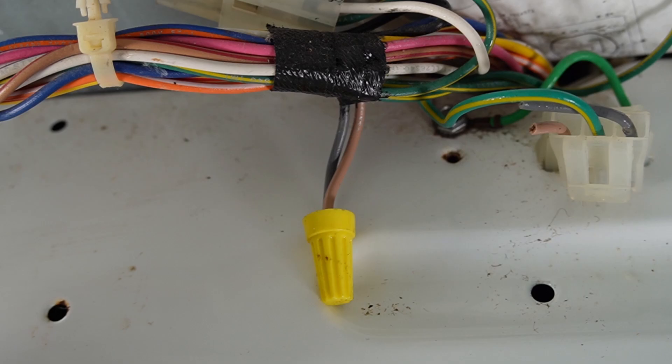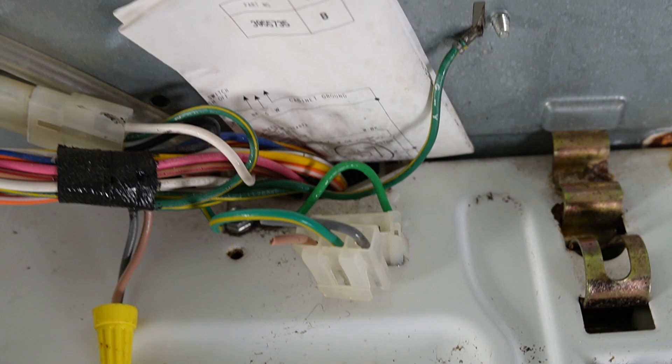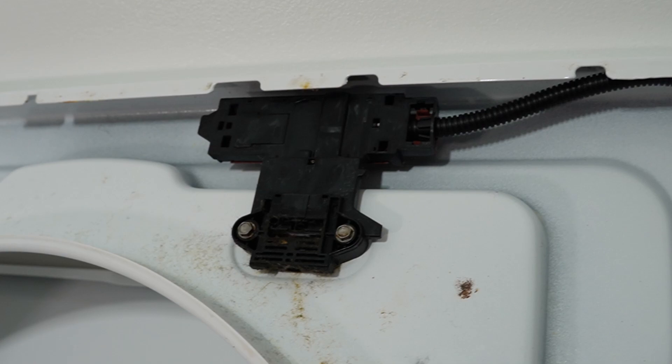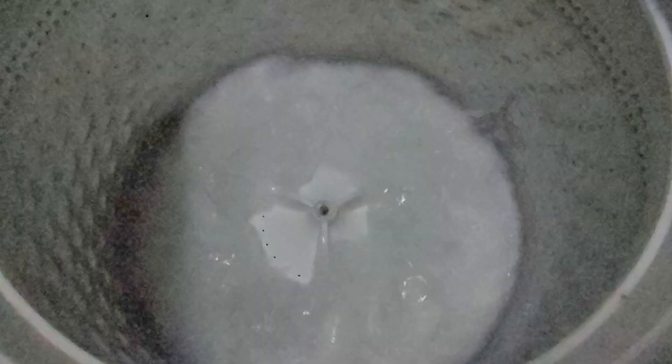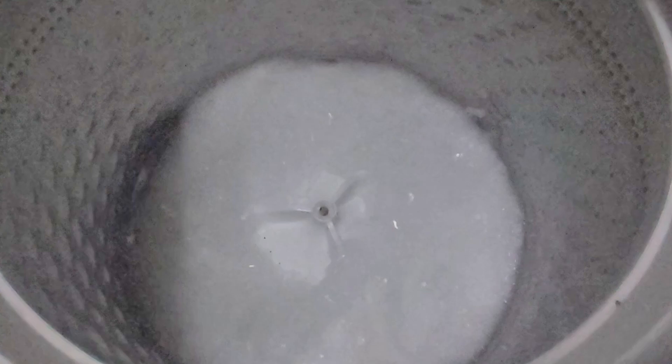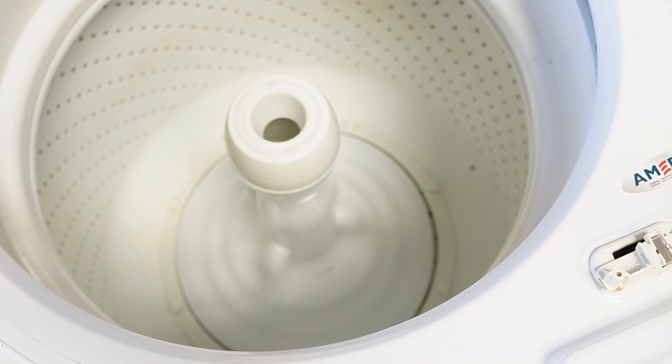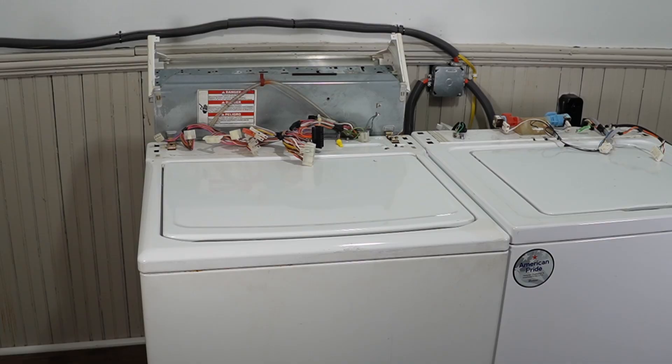One common area of frustration on newer machines is the lack of ability to bypass the lid lock. Here you can see wires spliced together with the remaining wires cut, which allows the user to lift the lid while in spin or agitation — which can be kind of dangerous. Electrically, newer washing machines send a pulsed on-off signal to test the lock and force the lid to lock entirely on almost all systems, preventing small hands from getting damaged. You can't bypass the lid lock if it fails on a newer unit, but there are workarounds to open the lid in spin mode for diagnosis, and I do have other videos on that in the description.